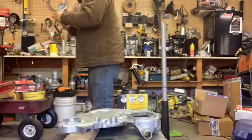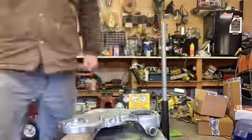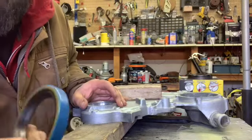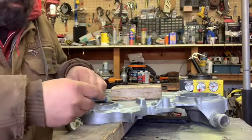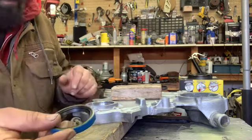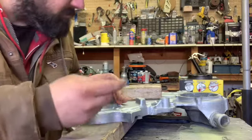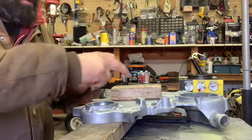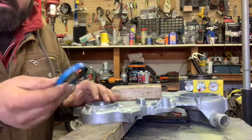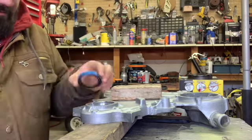All right, well, here's the new front crank seal, using the timing cover. Sorry, I feel like I'm about to sneeze. And so yeah, we'll go ahead and put this in. I already wiped out these surfaces and cleaned them off. Just like any seal, trans seal, or any other type of seal that pushes in like this.